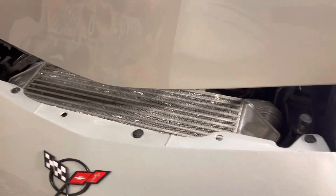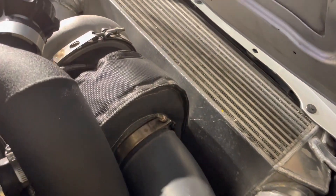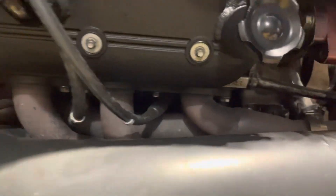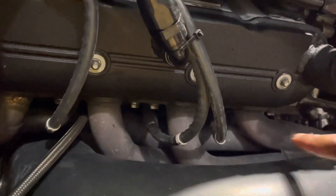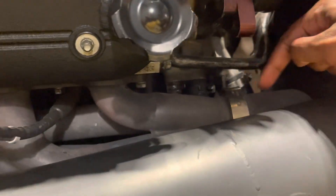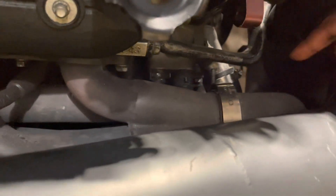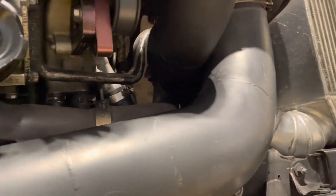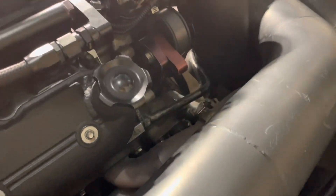I'm going to come around this side. The intercooler is V-mounted down there with the radiator. On this side, you can see a little bit more of the V-mount of the intercooler. The 5-inch downpipe is back on. Right here you can see my top manifold — handmade manifolds. This one comes up and over just above the water pump outlets here. You can see how it runs down there, and I'll show you where the up pipes connect. I don't have any crossovers or anything underneath the car — it's all running forward.